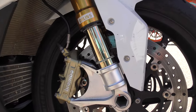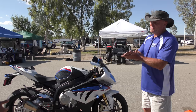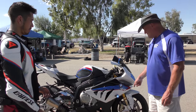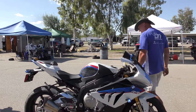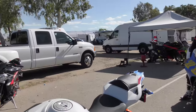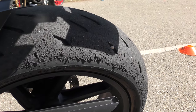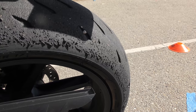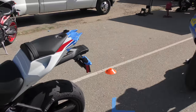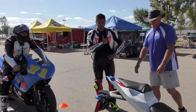On the money. As far as the travel you'd be looking for in the data on the car — for threshold with percentage travel — you want to be 80 to 85%, and that's exactly where you're at. Perfect. Because you were focused on braking, there's a lot more debris on the soft section of the tire this time because it didn't get anywhere near as hot — your focus was braking, not acceleration. Cause and effect can rapidly accelerate wear. Just slowing down a little bit on a bike can really accelerate your wear.